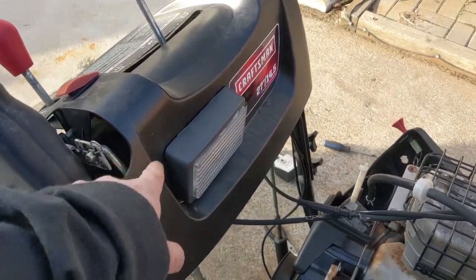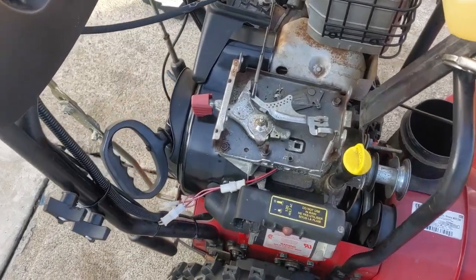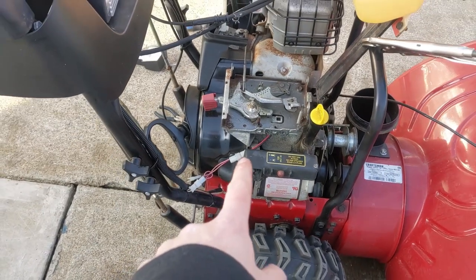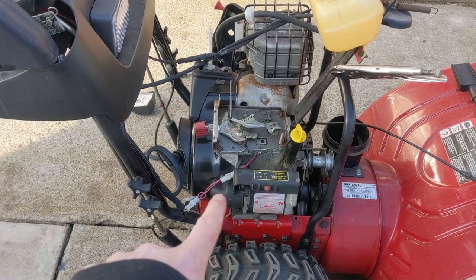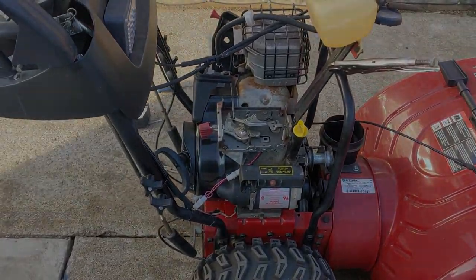I'll have to start doing some checking — I don't even know if my stator alternator has output at the alternator. I'll probably fire this thing up again, unplug it, and start probing to check to make sure I'm getting alternating current there. If I'm not, the cover's got to come back off and I'll swap out the alternator for one I want to upgrade to — however, at the moment it's on back order.